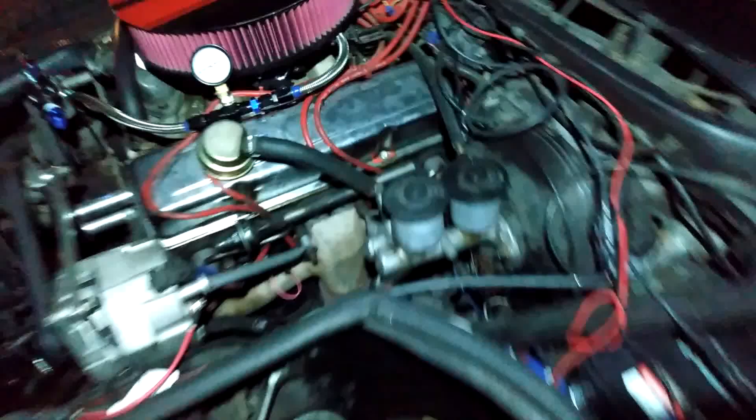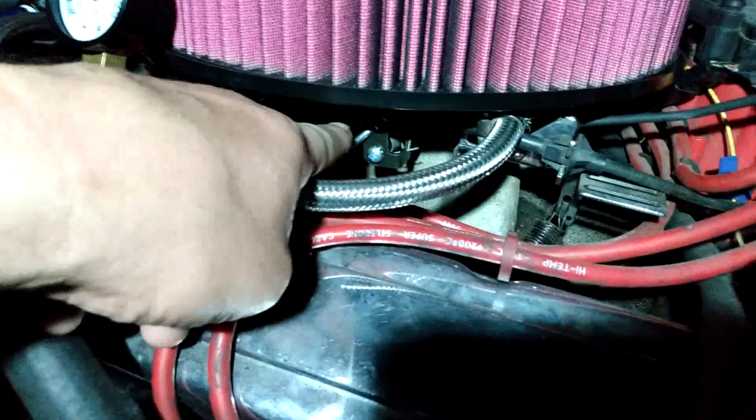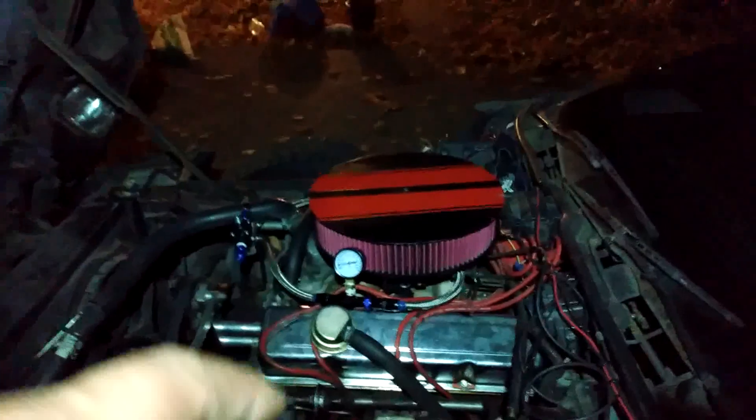Make sure you have that screw — there is a screw like a carburetor. I don't know if you'll be able to see it, but there's a flat screwdriver head deal in there. Turn that back. That keeps your idle low enough so it'll reach. I didn't do that and the thing was revving to like about 3,400 RPM. So back that out — that way you get the nice low idle that you want, and then you can fine tune it with the touch pad.